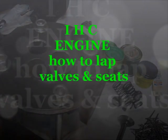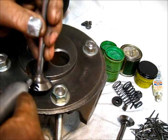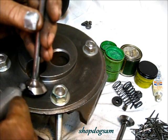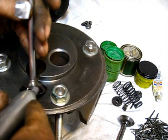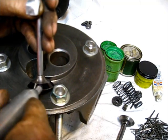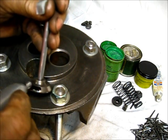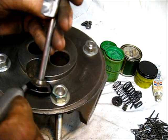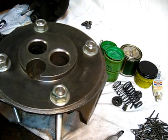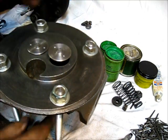Back to the workbench — seats are cut, valves are faced. To get a visual, I'll put a little layout die right on the face of that valve. We're going to do both of them, just a show-and-tell. Put your layout die right there on that one also. This will tell us where the seat lays in the face of the valve. The exhaust valve goes down here — put that down in there and give it a few turns. The intake valve goes up here — let's give it some turns.